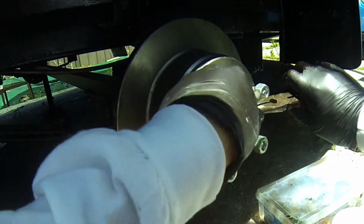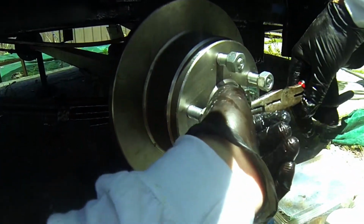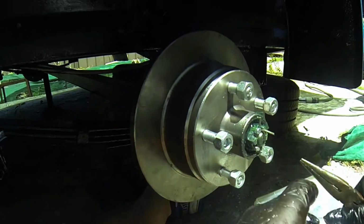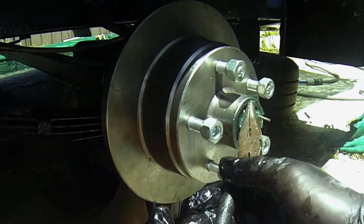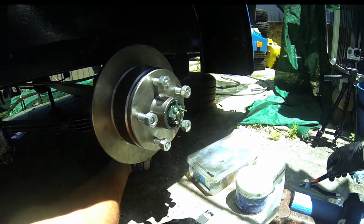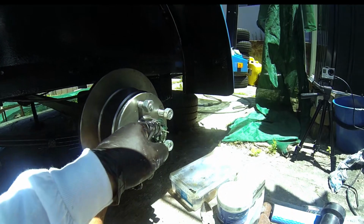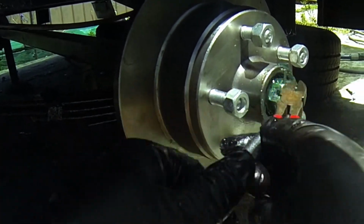So the top of the pin just bends away at 90 degrees like that. There it is. Okay, I'm going to knock that home. I'm actually going to flatten that onto that next. But this one here is always a little bit long for that little bit over there. So I'm going to use my side cutters and I'm going to just work this away and make it a bit shorter. Okay, now you know it can't drop out.